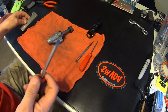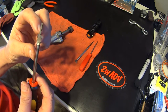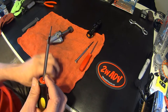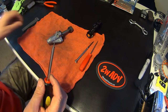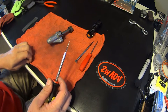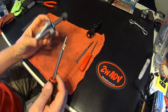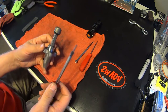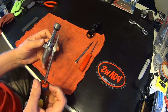Three and a half millimeters — so three and a half by eight millimeters, about 19 millimeters on the shaft. It doesn't really matter too much as long as you make it narrow, around one to one and a half millimeters wide. I'm going by the manual — it shows you how to make one. Because when you buy the tensioner it comes with the tool, but I'm going to show you how to rebuild your existing one and save about a hundred dollars. Just make your own and you have a permanent tool for future use.